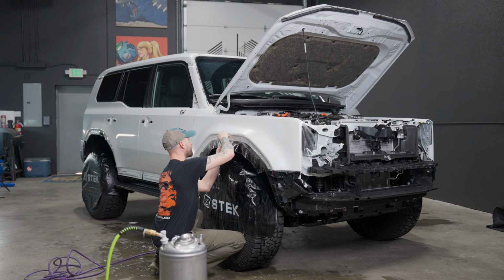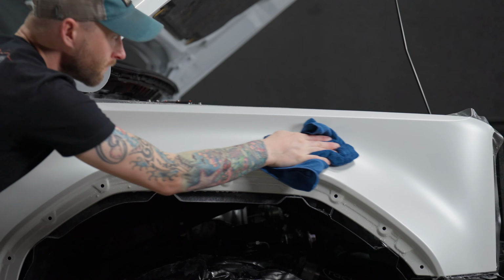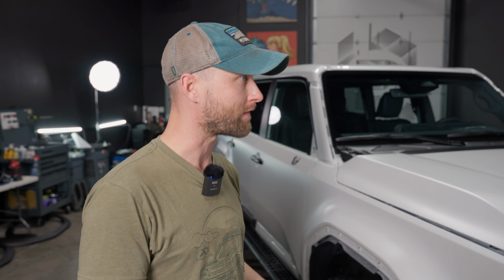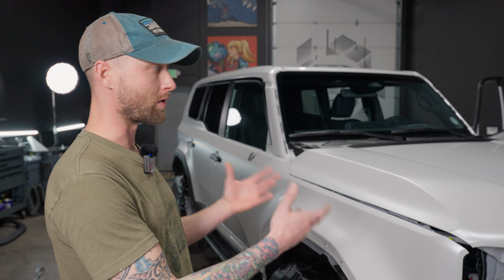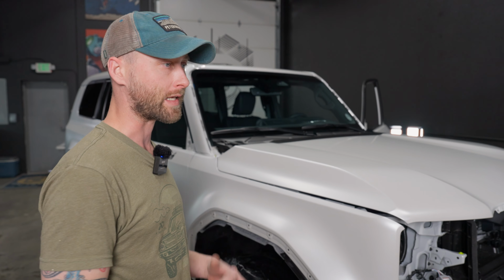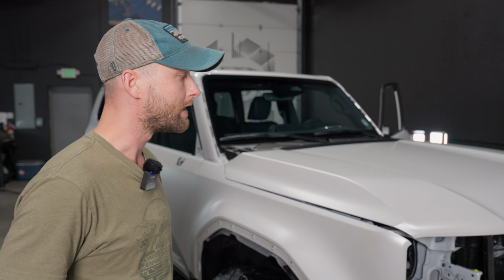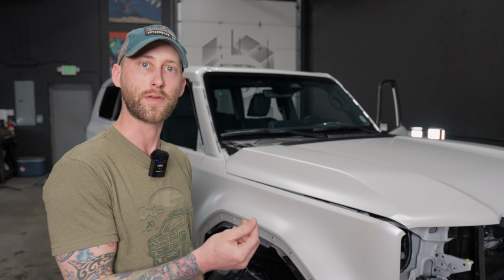So you've seen demos before online, I'm sure everybody's seen them, where people are either pushing screwdrivers through PPF to demonstrate it, or they're literally keying a car because it kind of self-heals. And how does that work, man? Like, what do you do if you get scratches on a PPF wrap? Yeah, I'll put it this way, it's a preventative measure, right? So like anything hard enough, you can eventually get through it. But the nice part is most scratches and damage done to it will self-heal with either hot water or the sun. Heat is friendly, so it dissipates any of the micro scratches or the deeper cuts into it. And essentially it's the top coat that is the self-healing film.